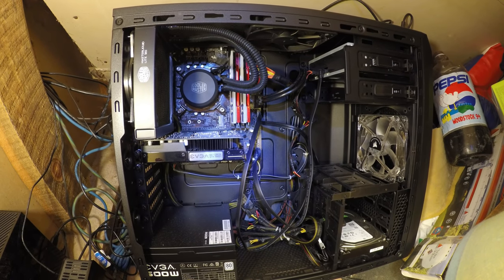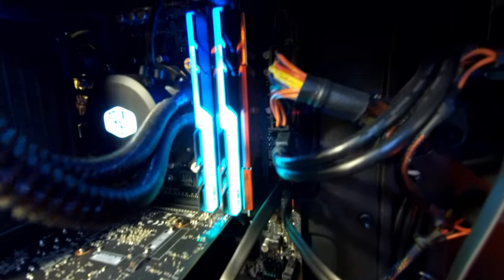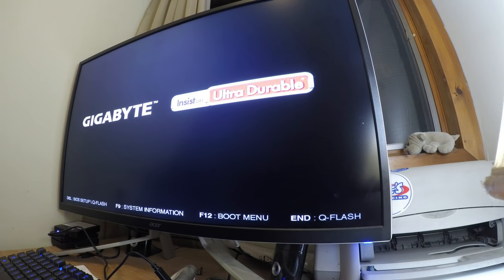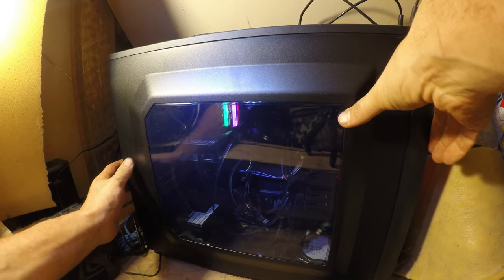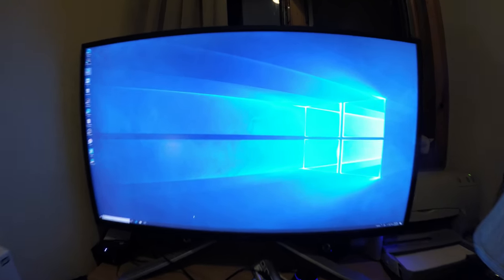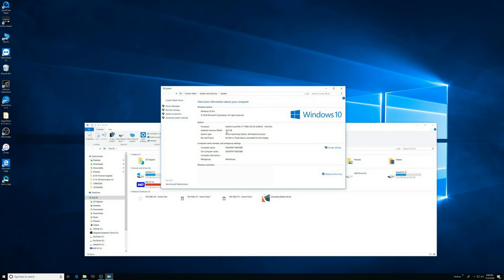It's in there, let's turn it on and see if it works. That's pretty cool — it lights up! I'm sure that's working fine, I'll just put this cover back on. You want to have these covers on because the air doesn't flow properly through the case without them, and it needs to cool down. Let's go to My Computer and see if it's working — Properties. Installed memory: 32 gigabytes. I had 16 before, so that's working.